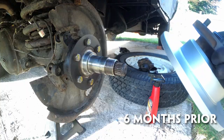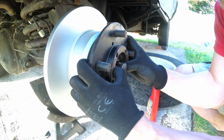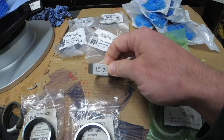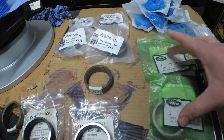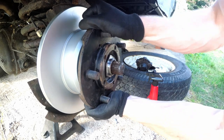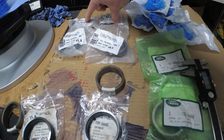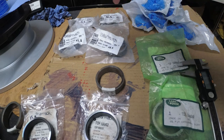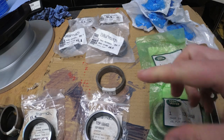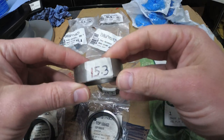This is the range of spacers I've got. The right-hand hub on the vehicle actually needed a 15.2, which is what came out of that vehicle originally. I fitted the 15.2 back on, then checked the end float and it turned out there was zero end float, so I wasn't confident it was the right spacer. I went ahead and bought a 15.5, checked the end float, and it turned out 15.2 was correct. I've also bought 15.3, 15.1, and 14.9 — the more cost-effective ones at about two pounds each.